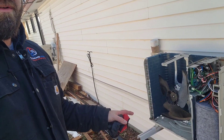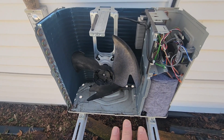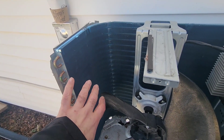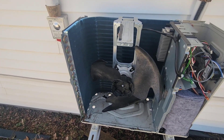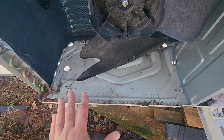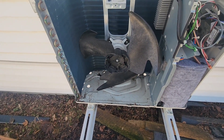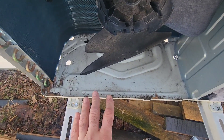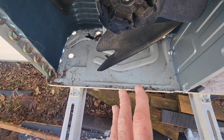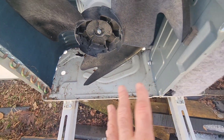What we're going to do today is install some drain heaters on these outdoor heat pump units. The reason we need to put drain pan heaters on the bottom of the outdoor unit in a cold weather heat pump is because we have ice and frost that can build up on the coil in heating mode. When it goes into defrost, all of this ice and frost is going to melt. Because of gravity, we have this pan here — it's all going to end up here. If it's below 32 degrees or below zero C, that water moisture can freeze up, build up, and block the fan from moving. So a drain pan heater is going to melt that water and it's going to exit out these holes here — that's what those holes are for, to drain any moisture or water that's there.